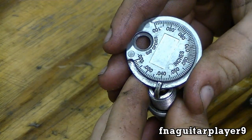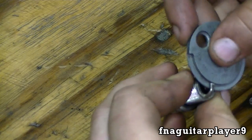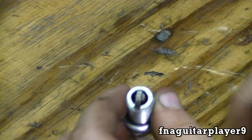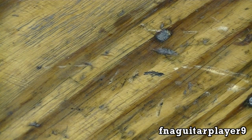Now I've got it to about 40, so I'll need to go some more. Sometimes it takes quite a bit to bend them — they're usually set a little big from the factory. Now I've got it set at about 37 thousandths, so I still need to go just a little bit more. You want to check it often while you're bending it.